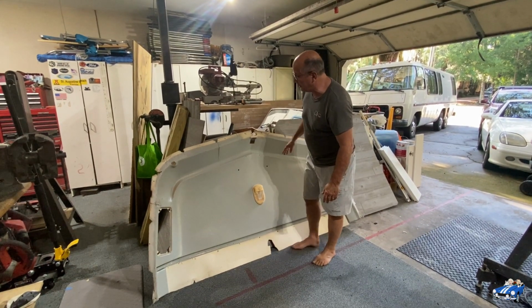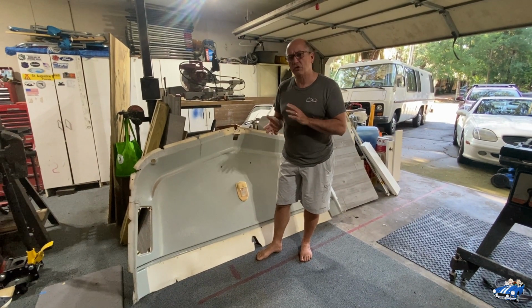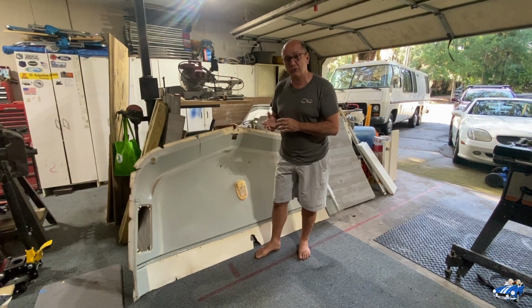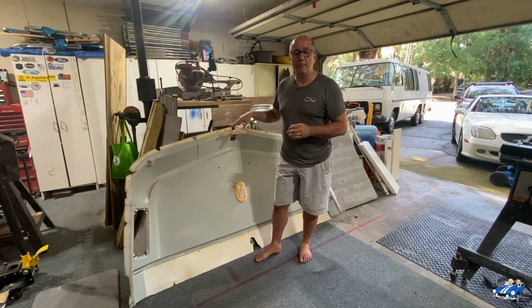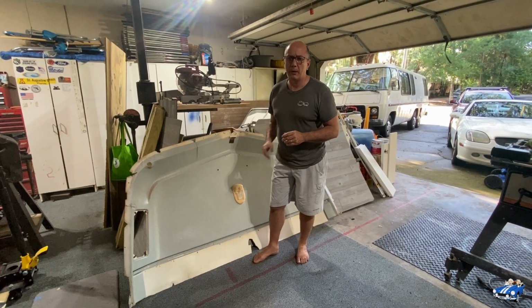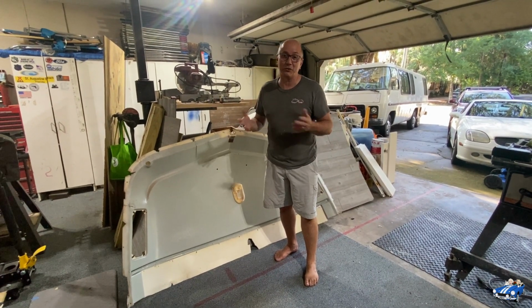So what we're gonna try to do is we're gonna use one of those plastic mending tools, and I'll show you that in a second. And we're gonna try to go ahead and adhere all of the joints and cracks together first, so we can get the stability of the unit back together. Once we're there, we're going to go ahead and epoxy or bondo. Haven't figured out which one's going to work best on this particular material. Probably it's going to be epoxy. Then we'll cover all the cracks up. Then we'll sand it, we'll try to texture it, and then we'll try to paint it.